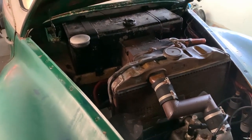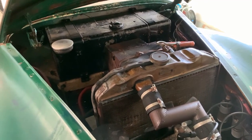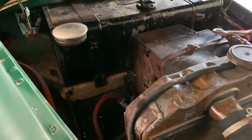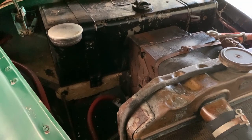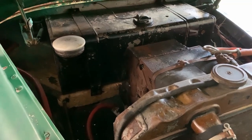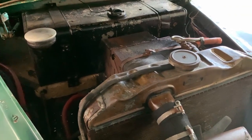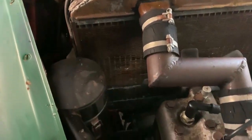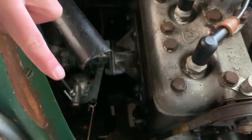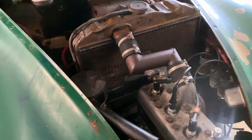Another very important system for the engine is the fuel tank. As you could see in my last video, I built a little temporary fuel tank just to start the engine for a short time, because the original fuel tank still has some old, dirty fuel inside. I'm going to take the fuel tank out and clean it inside, disassemble the fuel stopcock, make sure it works, renew the fuel pipes to the carburetor, and install a fuel filter.